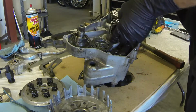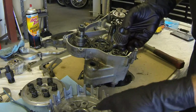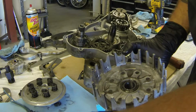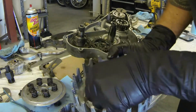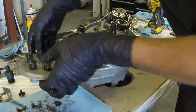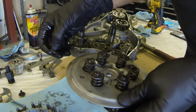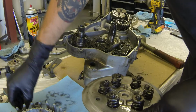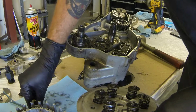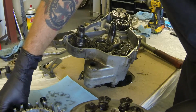So bearing there. Inner race. So you want to keep this stuff in order. Do your best to anyway, including the spacer, all this stuff. Just kind of keep it in order. It will take up less space, and not only that, see, washer, bearing, fell off the back. You'll be able to see how it all came out later. Just something helpful.